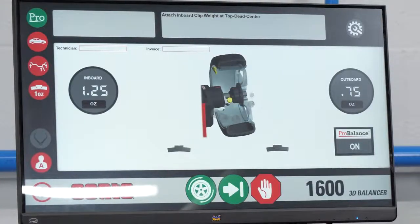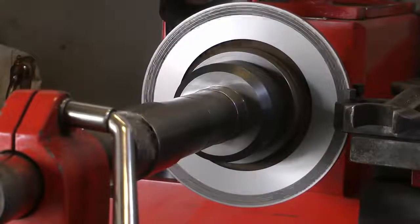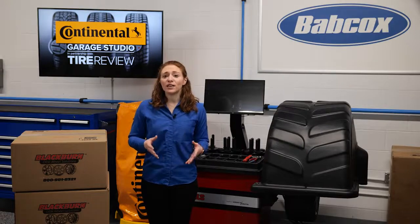This is the same principle as doing a scratch test on a bench lathe before machining a brake rotor, which verifies the lathe setup. This helps to ensure that the rotor is centered on the arbor and that the runout is in the rotor.